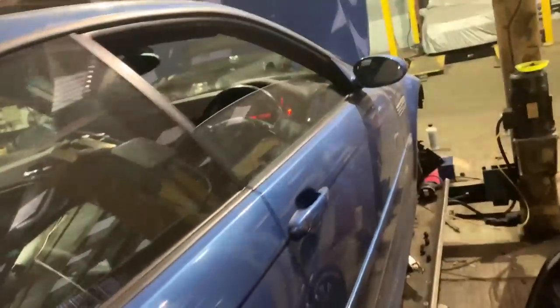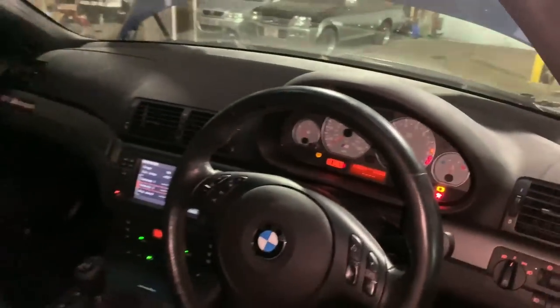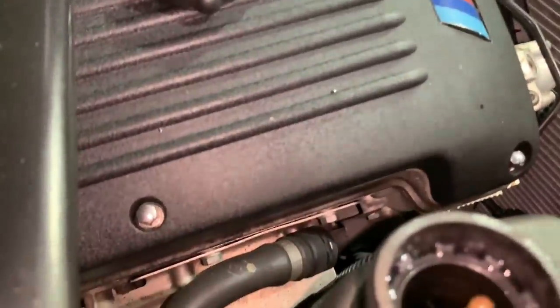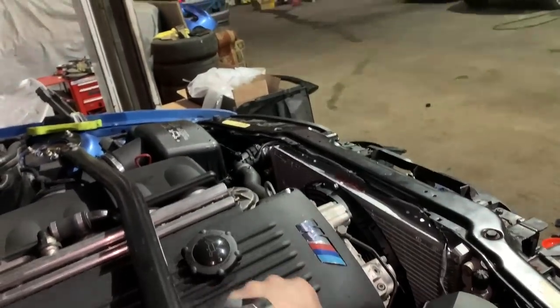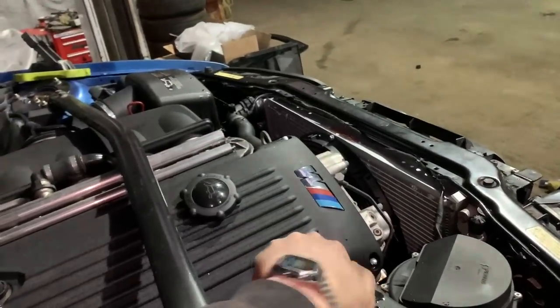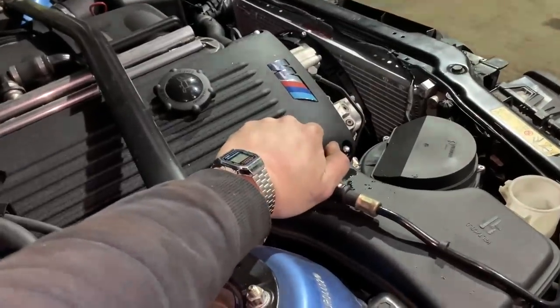How's the cooling doing? That light's gone off. I put some more coolant in the expansion tank. So we better put the cap on actually, or else she's not going to be getting pressure, is she? I put the bleed screw back in because it just kept coming out. Like, what are you doing? Not heard the fan come on yet, but early days.